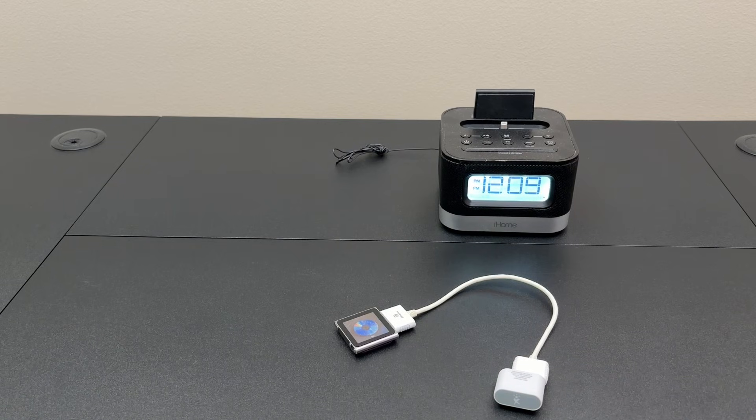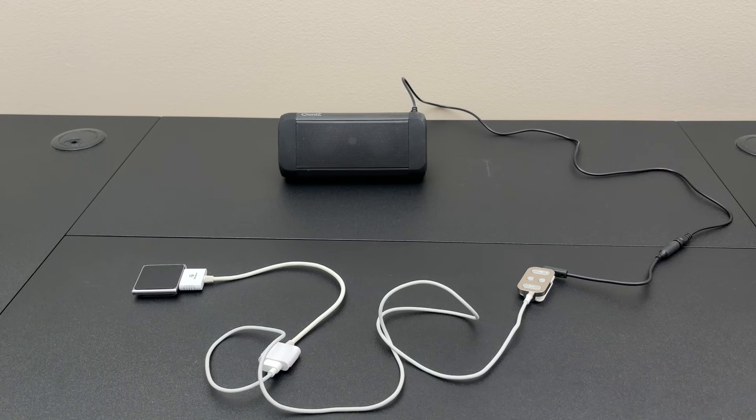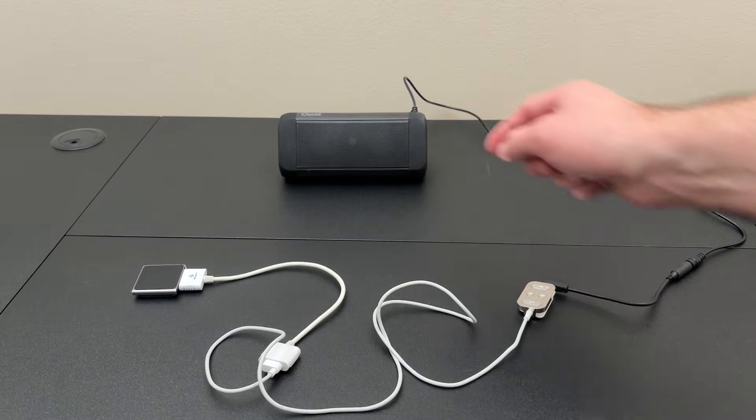Let's try out the remote control now. Here's Apple's remote control with this connector. It came with some of the larger capacity, higher-priced third generation iPods, but you could also buy it separately. They actually had one very similar for the first and second gen Firewire-based iPods — those had their own proprietary connector with a big ring at the bottom of the audio jack — but that never opened up an accessory market and there's no known adapter for it. To use this remote, you plug it into your iPod and then plug your headphones into the top.